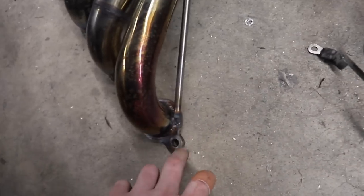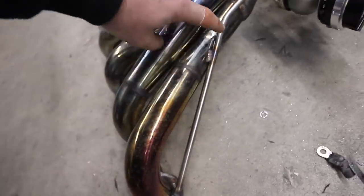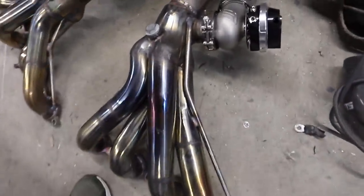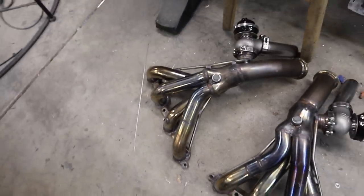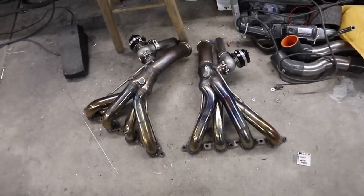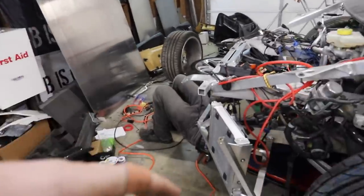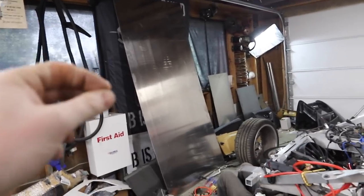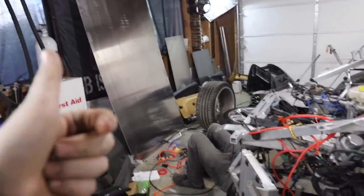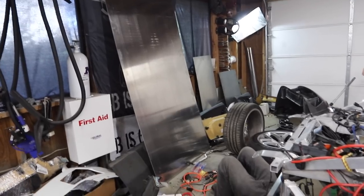The exhaust manifold supports are done. We kept it pretty simplistic — tying into the flange off a straight piece that doesn't heat up very hot. A lot of the heat comes in where they were getting red hot, so we're bypassing that, connecting up top to help take the load, take the weight, and solidify it against gravity. All welded up and done. Next they're getting heat wrap. Oscar is also going to jump into some front aero stuff — cutting up aluminum to make our front splitters. You guys always hate when we make front splitters out of aluminum, so I wanted to be 100% sure we did that on this build. No carbon fiber front splitters — too expensive, and these are basically just for show to make the car look like the rendering.